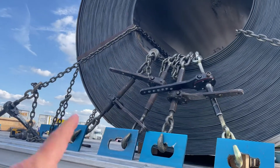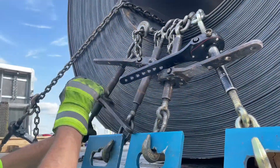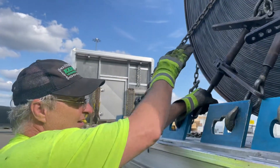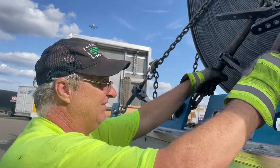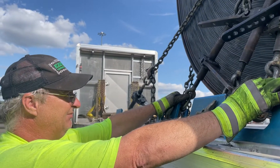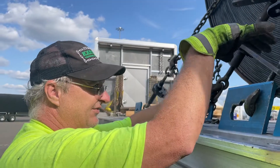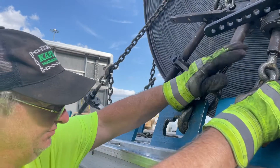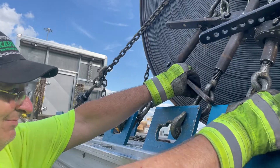You mentioned reactionary bars — explain what you're doing here. So, the reactionary bar gets negative pressure on it. By having negative pressure like this, it makes it impossible to move. These are really slack adjusters, just like what we use on our brakes, on our brake chambers, as we're running on our trucks on a daily basis. That reactionary bar has to have negative pressure on it, so when we tighten it down, we actually put the reactionary bar right on top of the other Speedbinder and tighten it up.